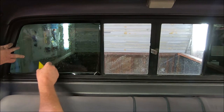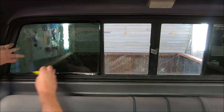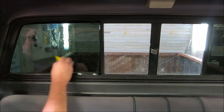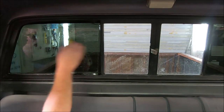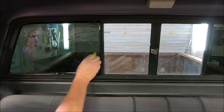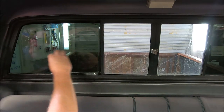I'm careful to try to get the film down to where it goes seated at the bottom. I'll make a pass across the bottom. The reason I do that is because I don't want water passing this line — I call this the Rubicon. So we get this down here like this, I tack it off, I put very little pressure on this. I'm letting the water catch over here in this corner, run down, and run out.